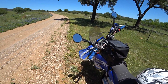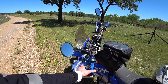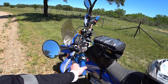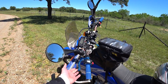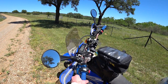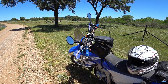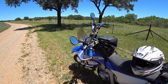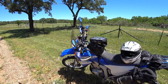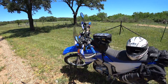One thing I really did not like about this bike is the clutch — it's really heavy. I got basically a stunt clutch lever off eBay, billet aluminum, and it works extremely well. I think these are 30 to 35 bucks — well worth it. It's easily a two-finger pull now on the clutch, which makes the bike much more usable. The transmission shifts extremely easy without clutching it, but all day after trail riding with the original clutch lever, my arm was pretty shot. So this really helps.